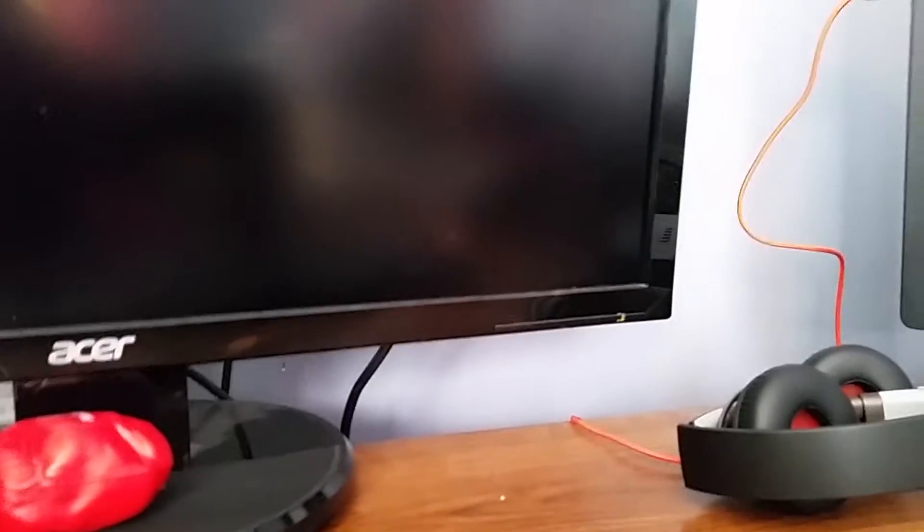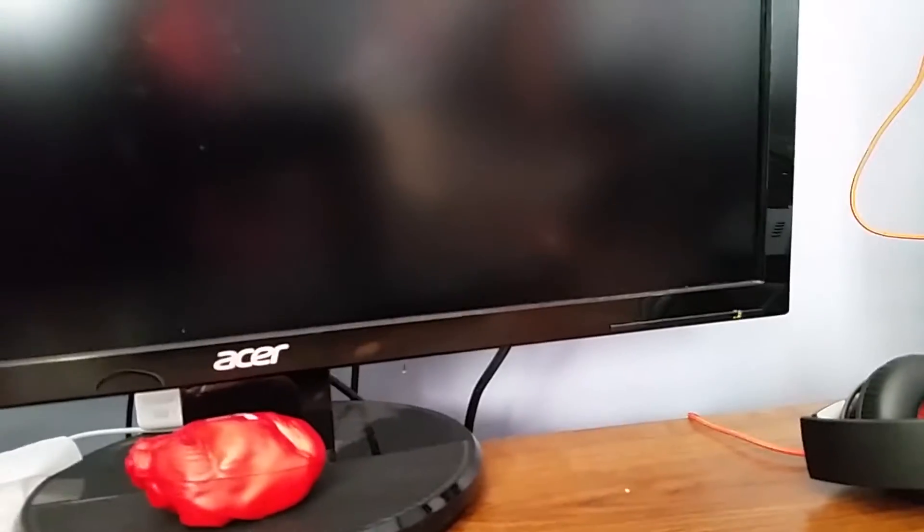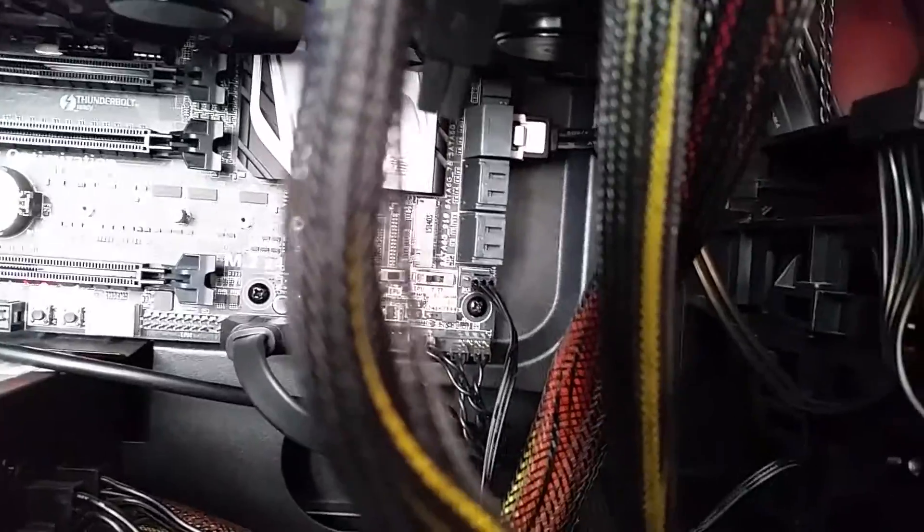The monitor is on, set to HDMI. I'm running an HDMI cord from the monitor to the video card — plugged in and powered. It's immediately error 61, and nothing on the monitor. I have the one drive connected as just the boot drive, and there's the 61 again.